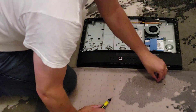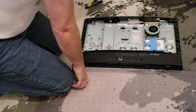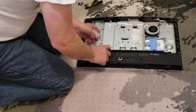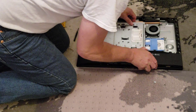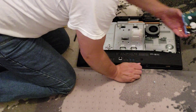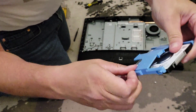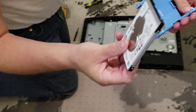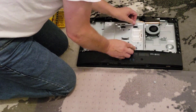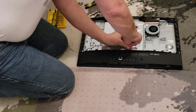I've never ever lost a screw on a computer — if you do, you'll probably get a short, so that's not good. Let's pull this out. I'm going to assume I slide it north — nope, just lift it up. That's getting caught. Looks like maybe the hard drive has to come out first. Yep — that's your hard drive mount, and that is unbelievably easy to change. It's all just flex mount, no screws — really nice, good solution. Oh, there's a screw I missed — so there are five screws to pull out.